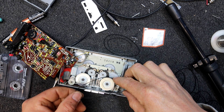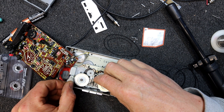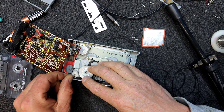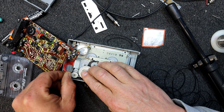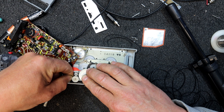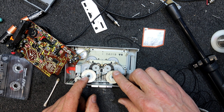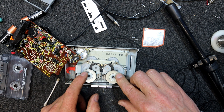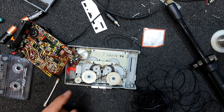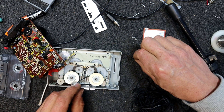I found a belt about the right size — let's see if it fits without too much tension. It's got to go around this capstan, under that one, and then under the lower part of this pulley. So far it's feeling like it's going to be pretty good, but it doesn't mean it will. A bit of a fiddly one to get on there — and that's it. That's better. Yeah, I think that's acceptable. That's pretty good — fairly non-slip.